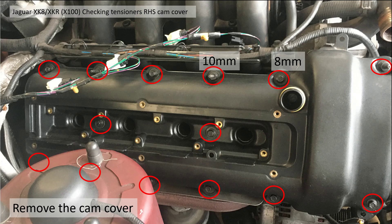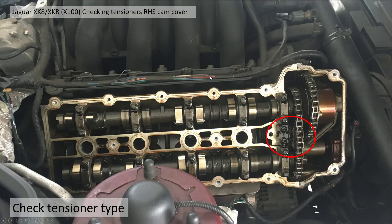You should now be able to take the bolts off the cam cover and the cam cover should just pull off. The bolts towards the bottom are particularly awkward because of the shock tower, so you may need mole grips applied directly to your socket to get it started — the access is quite poor. There are actually three different types of bolts across the top: every other bolt is an 8 millimeter across flats, but three of them are 10 millimeter, and you may need a deep socket because of the threaded portion coming out of the top.